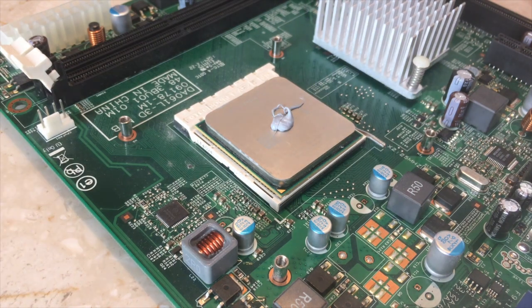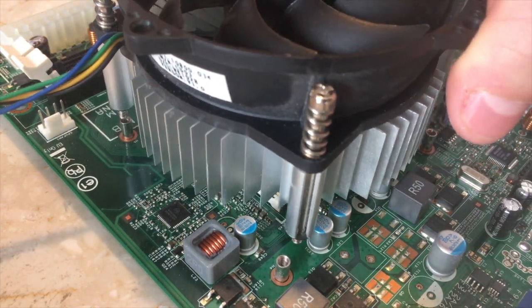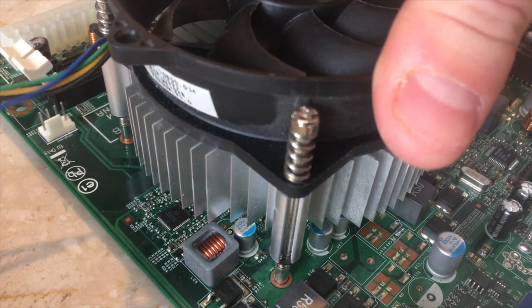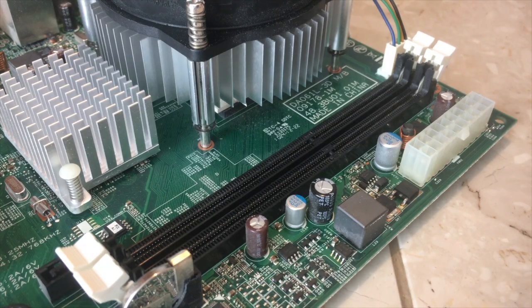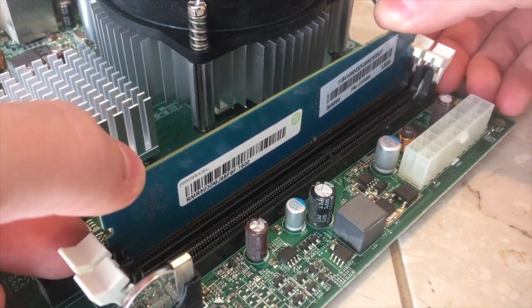This could be upgraded to a Phenom or other CPU for a bit more money in the future, but I decided to go with a more affordable CPU to keep costs down. I kept the original CPU cooler, but I would have swapped it out if I'd upgraded to any more powerful of a CPU. In order to have even a chance at playing more modern large tier games or any creative software, more RAM needed to be added.